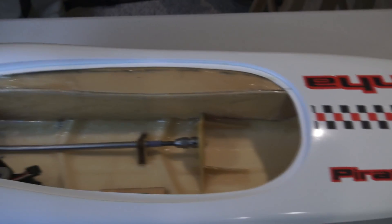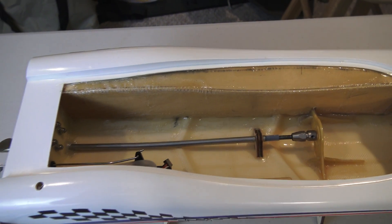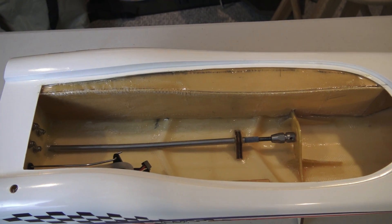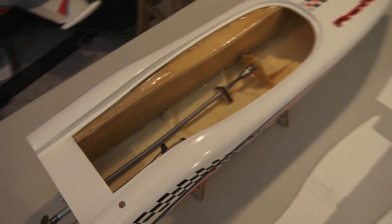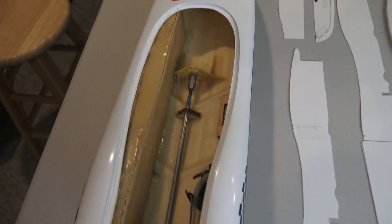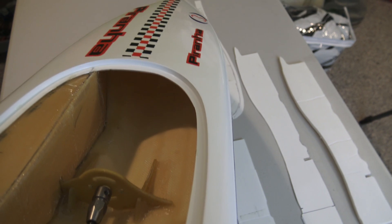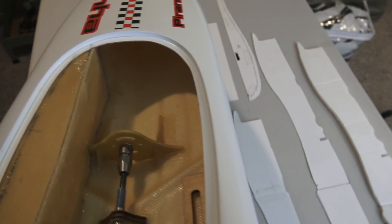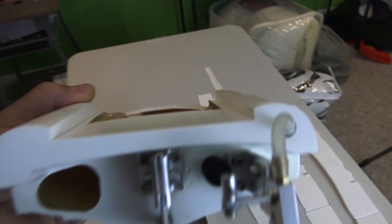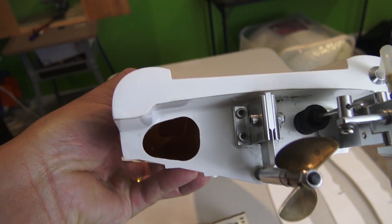I made my flood chamber out of wood and also reinforced it with some fiberglass cloth, and glued it in with a 20-minute finishing epoxy. It was quite difficult getting the template fit right because it's hard to see inside the front of the boat. After I got it all fitted up, I found it was easier to see the front if you cut the hole in the back of the boat first, so you can stick a flashlight in there to see inside.